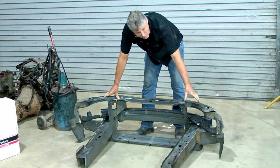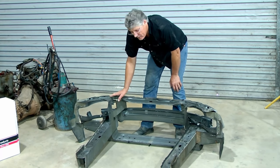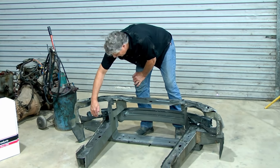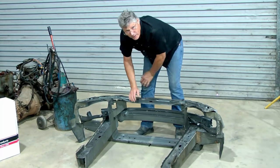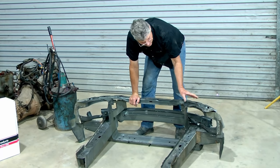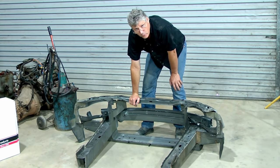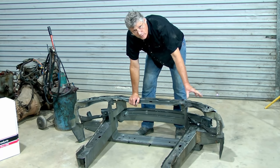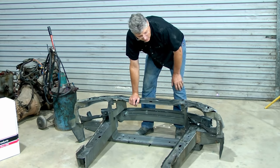This is the replacement section I've salvaged from another car. I've done all the prep work bar cutting the rails - drilled all the spot welds and taken all the pieces I don't need off these sides. On this side, I've drilled the spot welds and taken all of the fender skirt out, so when it goes back together my original skirt slides in over the top of this bracket and tucks underneath the headlight support. On the other side, my car was damaged, so I've cut the panel off across there and we'll push them together and weld them. I've chosen a spot to weld that I can get in, do the weld, and finish it. More importantly, I've chosen a spot that if this car is in a future accident and there's a catastrophic failure of the weld - unlikely but possible - it's not going to cause any great damage.